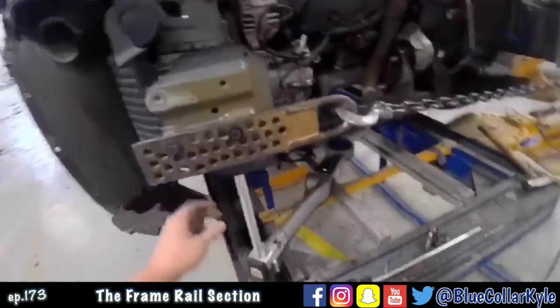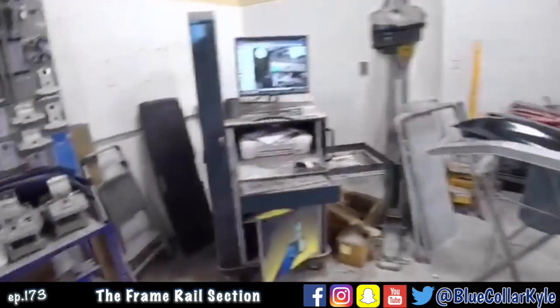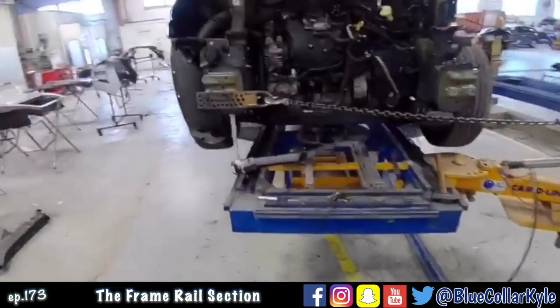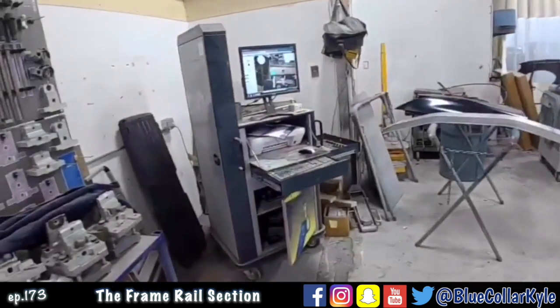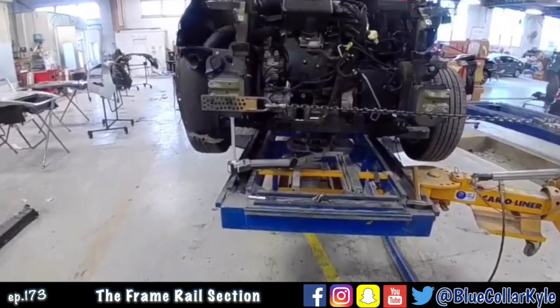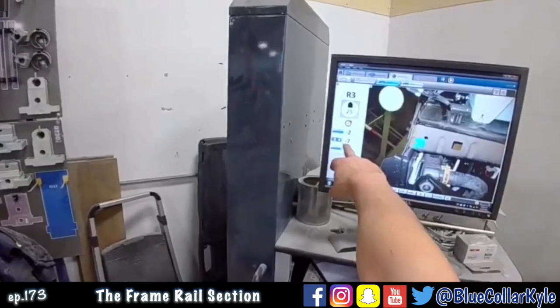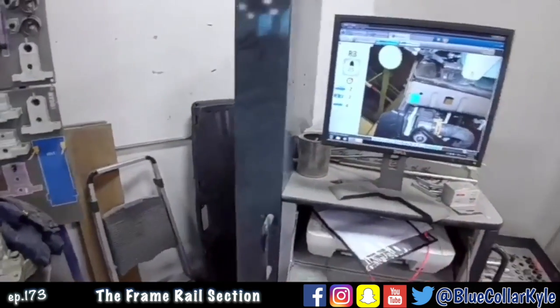Now I'm going to do a live pull on this one. I'm going to leave this on that point right there, and then I could watch my numbers change as I pull it. Now you see I'm a -7 now. I was a +8. So you have to over pull it a little bit and then relax it and try to get it to where it equals out right where you want it.